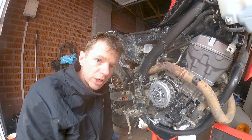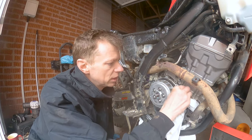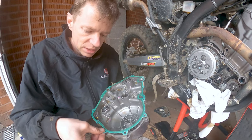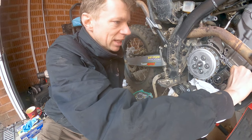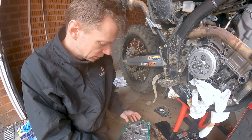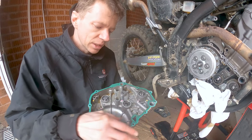All that's left is to clean up and get this ready for the cover going back on, replace the gasket, bolt it all together and we're done. This mating surface should be really nice and clean when you put the new gasket on, so it's worth spending a few minutes going around it all. Just while that's draining — here's our engine case and the gasket we're going to replace. Worth noting there are a couple of dowels — one right here in my hand and one in the engine case by that coolant pipe — they locate the cover. You might want to relocate them to the actual case just to keep the cover in place when you put it back on.